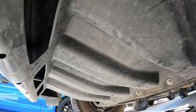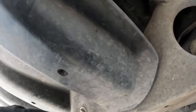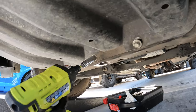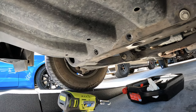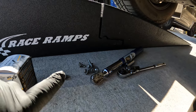One thing I didn't mention yet: to get to the oil filter, which is tucked back there, you need to remove this plastic shield. I'll grab some sockets — turns out they're 12 millimeters. Go ahead and remove all of them — seven 12-millimeter bolts total — and get this shield off.